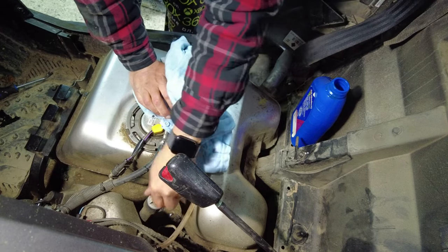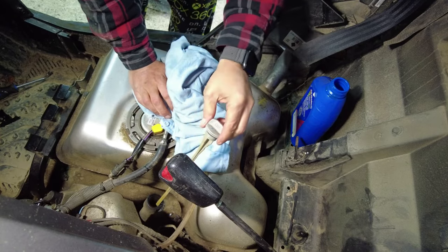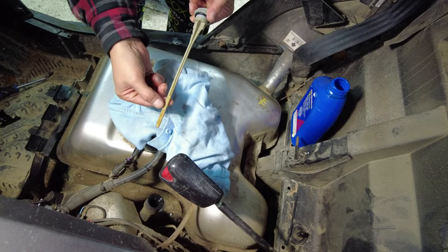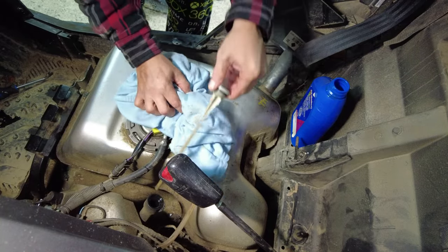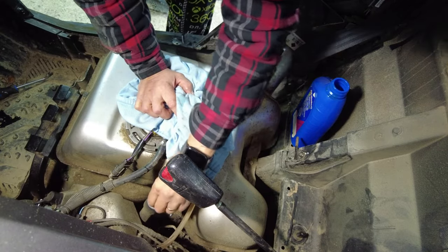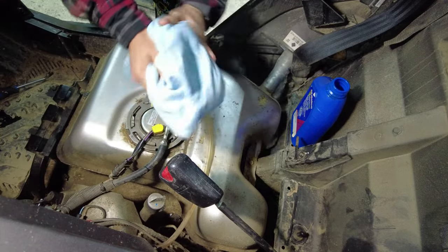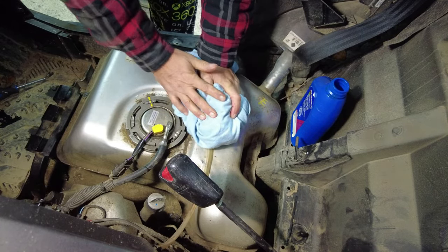So to check your oil level, you thread your dipstick all the way in. And we pull it out. And you'll see the wet marks. So right now, if you guys can see that, I am at the top of the hash mark. So that is the full 2 liters that's in there right now. And I suspect once I start it and the oil circulates, it is going to drop a touch, because remember when we took the oil filter out, that whole housing emptied of oil. That probably holds a good 1/4 liter or so. All right, let's get this thing started up. Start it up for 20, 30 seconds, and then we are going to recheck the oil level.